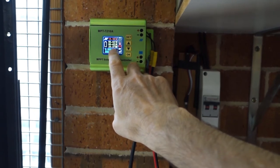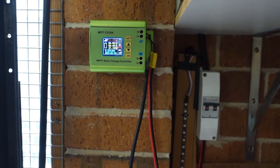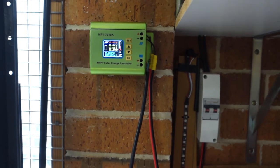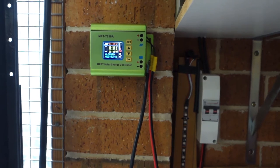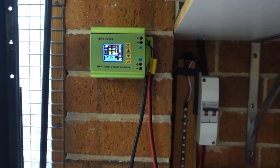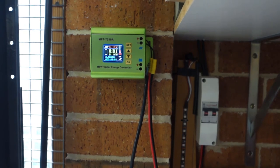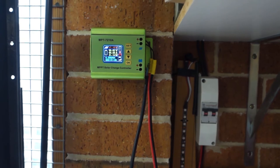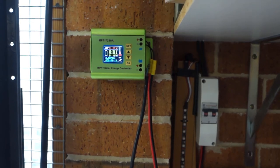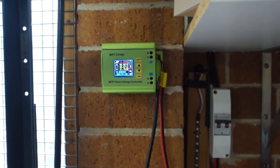Just a little aside on solar panels — the panel is rated for 200 watts, but when do you ever get 200 watts out of a 200-watt panel? Very rarely. They are all tested at standard test conditions of 25 degrees centigrade, imagining you're on the equator at midday — perfectly ideal conditions. In reality, even here in Sydney with my panels pointed at 30 degrees, it's not the middle of summer — it's the end of summer and it's an overcast day — so you rarely get more than 140 or 150 watts out of a panel rated at 200 watts.